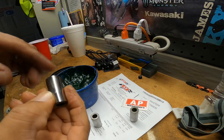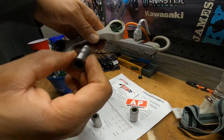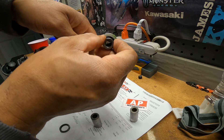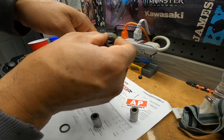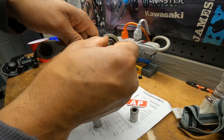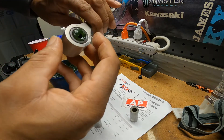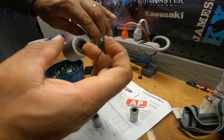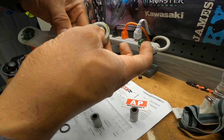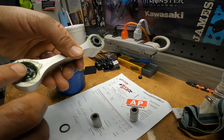That's nice and clean now. I've never really done a video like this before, so pray for me. Now you just take it, line it up and push it through very gently, turning and twisting as you go. And you see on the other side, you should have that — what that means is that grease has been pushed across the entire bearing surface. That's what you want.